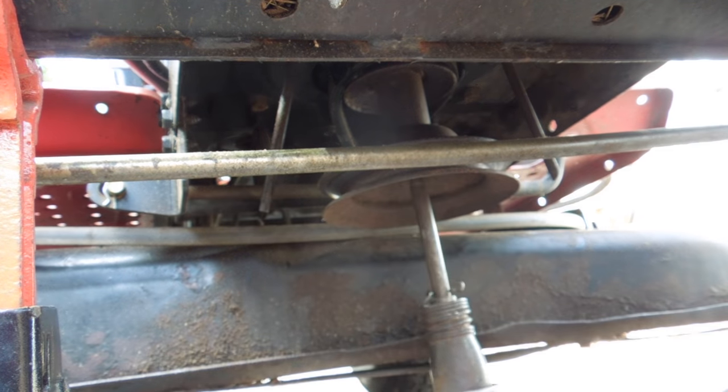I'll set the camera down while I feed this new belt through. I got the belt fed through there — you can see there's a keyway in the shaft and a key on this part here. Let me get my bushing in there first.